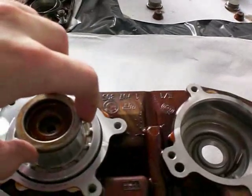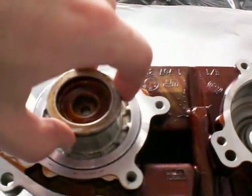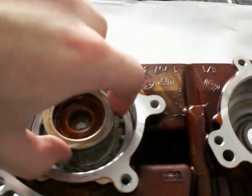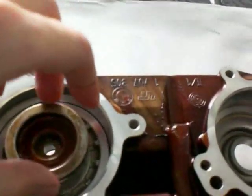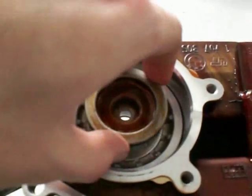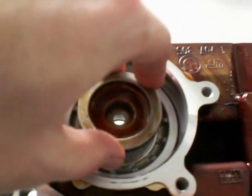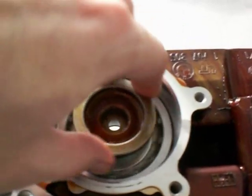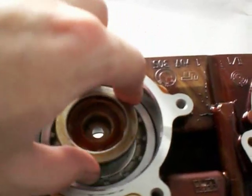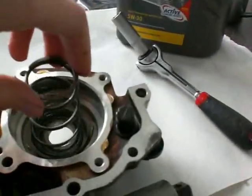As you take the intake piston, all cleaned up, you can see that it moves very freely inside the Vanos cylinder. You can hear it as you try to wiggle it around. So you can imagine that pressure buildup is very difficult with these seals being deteriorated this far. It's actually even more interesting if you look at the exhaust side.